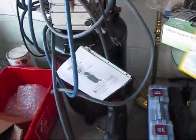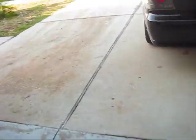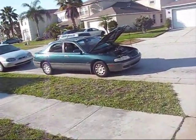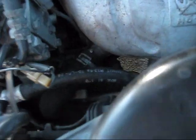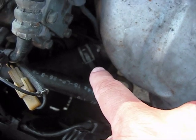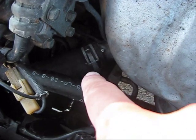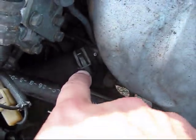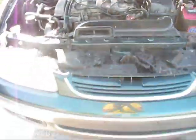Everything is done. I flushed the radiator twice using Prestone flush and tightened all the connections. At the beginning it was leaking over here — the problem is that I did not sand the pipe. So I removed the hose and the clamp, sanded the pipe with sandpaper, then reinstalled everything. The leak stopped.